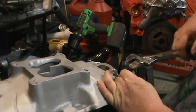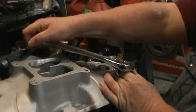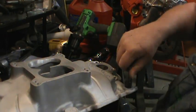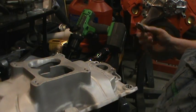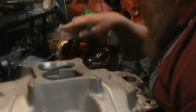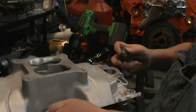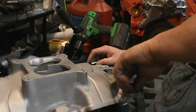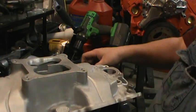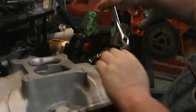There we go. With a pipe thread you don't want to run all the way down because your tap gets wider as you go deeper. I don't want to call that a success - oh yes, I like that. I'm happy with that.